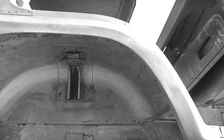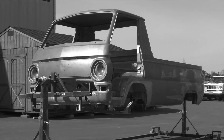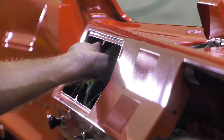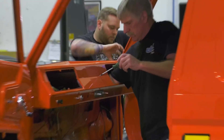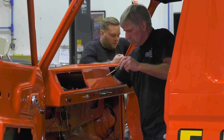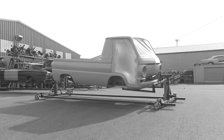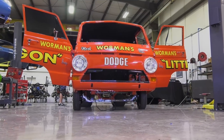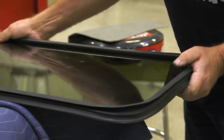This particular case, this is a true unibody. The frame rails are built into it like a unibody would have, but everything in it — the framework for the instrument panel and for the radio, the things that will bolt into it that will make it a street-functional unit — they're actually welded into the body itself, so I can't take those out and put them in a sandblaster and blast them all up and make them pretty. We'll have to do all that stuff in place. To be able to move forward with getting the rest of the interior in the truck, we've got to be able to put the back window in. It's going to be up to our team to get it installed.